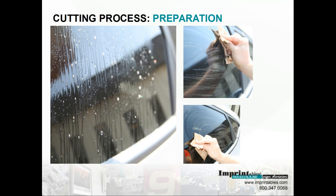Then lightly squeegee the mask from side to side or top to bottom to ensure a good bond with the mask. Then you're going to pull it off. Here are some pictures of the application. Proper application is crucial for the durability of your graphic. We recommend a temperature of around 40 to 90 degrees. Wash and rinse the application area with detergent, soapy water, or you can use the RapidPrep spray. Then dry with a clean, lint-free towel or cloth.